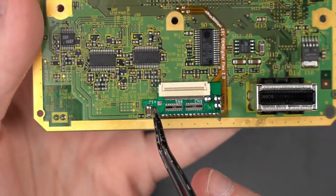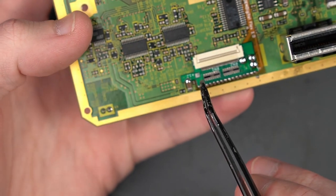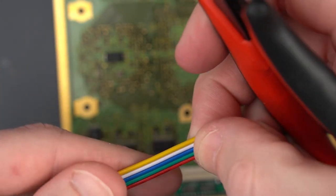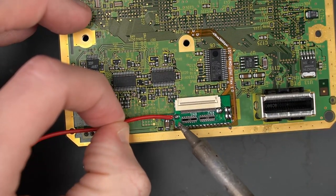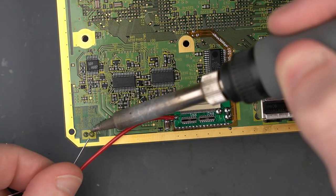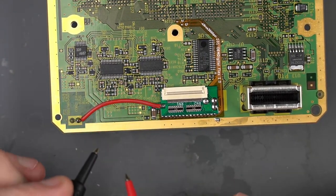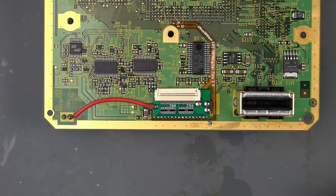Next, we have to connect this 12-volt pad right here to the right point on the fan header. We're going to attach a wire from there to the right leg there. Dan uses pretty thick cable in his video, so I'm going to use a piece of 22-gauge ribbon cable. I'll tin this pad, tack it down, tin the other point, measure the wire, cut it, and solder it on. Dan recommends using a multimeter to test continuity to make sure none of these points are bridged — everything looks good.